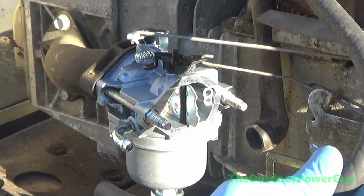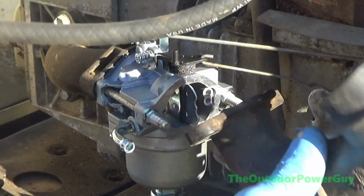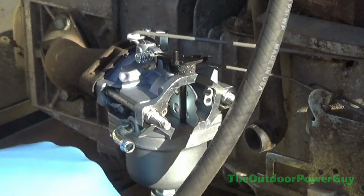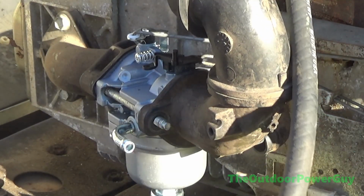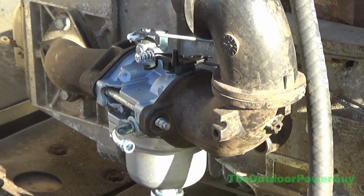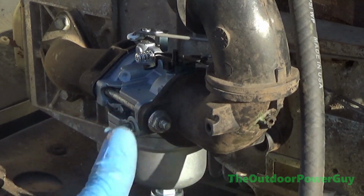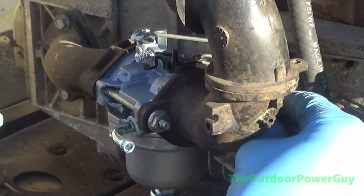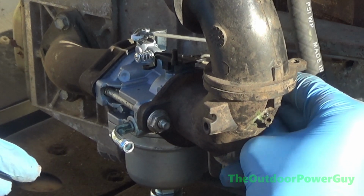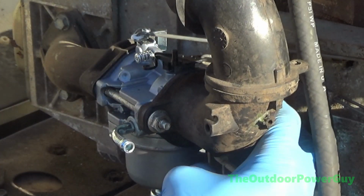Alright, so we're going to go ahead and plug the gas line in now, or do I wait? I'll go ahead and put the snorkel on real quick. Now, that red O-ring, you don't have to change it. Obviously, I recommend changing it, but I'm not going to change it. It looks alright. So we're going to take our nuts here. And I always put one on by hand so it stabilizes this. A lot of people have trouble getting to this back one. There's a tip. When you take your cover off, it's fairly easy. See there? Spin it right on there.